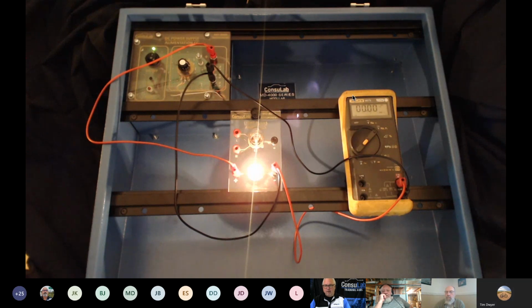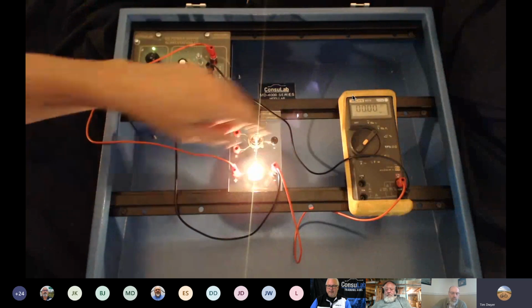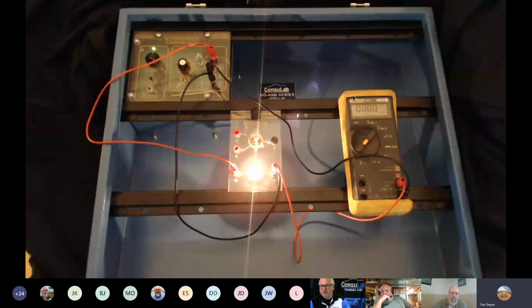So that wire, Kirchhoff's law tells us that there is a voltage drop anytime there is current flow. Okay. So what's telling us there's current flow? The light bulb right now. The fact that it's lit. Yep. Okay. And the meter is saying there's 0 volts on the backside, which is, you're saying, to do with that little decimal point right there. Yes. I would say that the student needs to understand that that reading is not accurate enough, because there is current flow, there must be a voltage drop, and you're going to show us that.